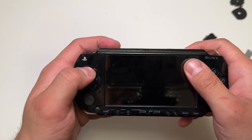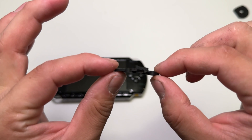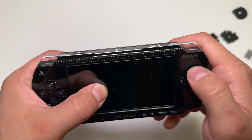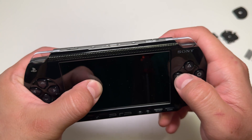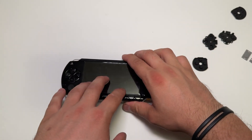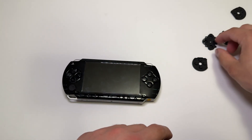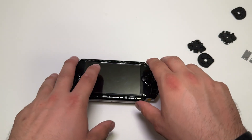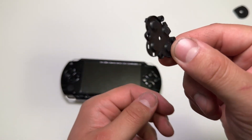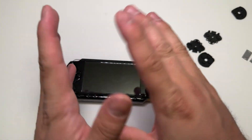I will say I actually don't like the feel as much. I find that the old one had better feel, probably because it's thicker — it probably just had a little bit more spring back. These feel slightly more mushy, they don't feel as clicky. But again, this one's not damaged, this one's not worn out. So that did fix my problem. For people where maybe the X button or something doesn't work — if you took it apart and cleaned the contacts — I would suggest just getting one of these. You can buy a parts PSP, and you might get a better, heavier membrane that's the factory one, so it might work better. But there's also a chance that it's also worn out on that square button.